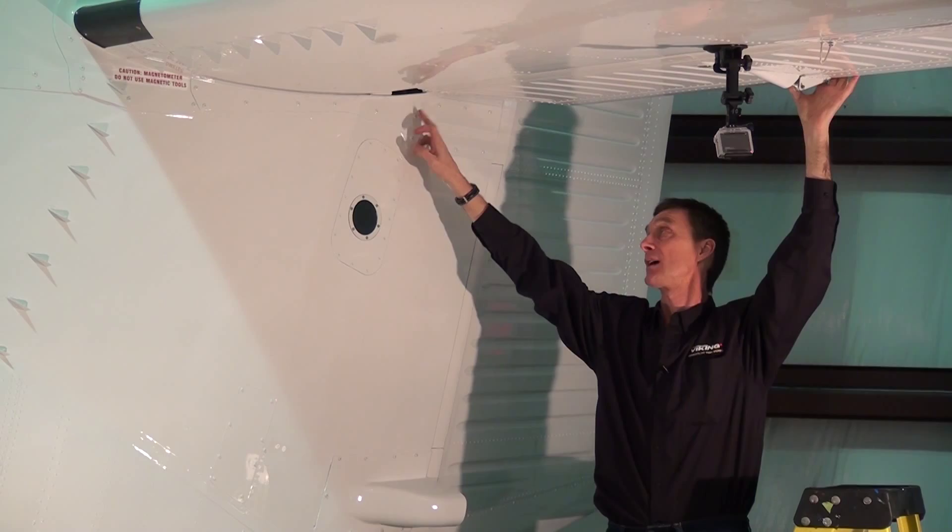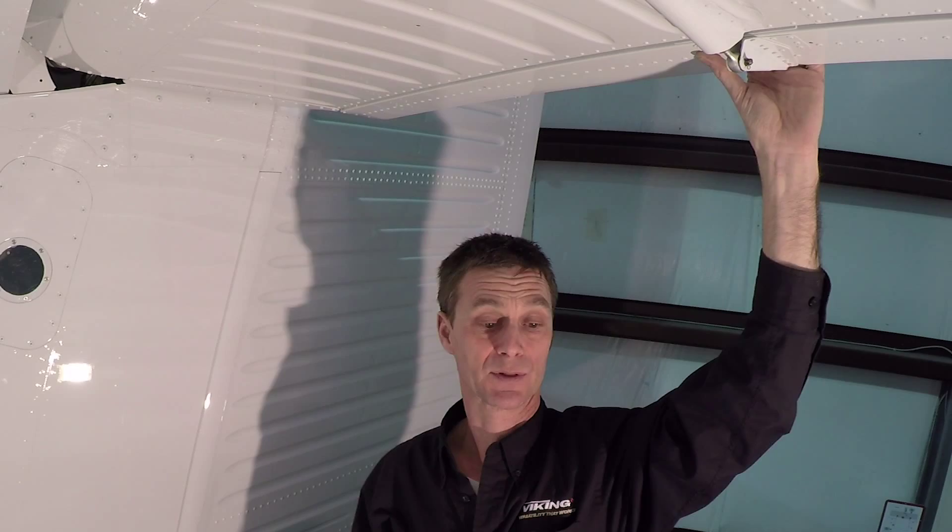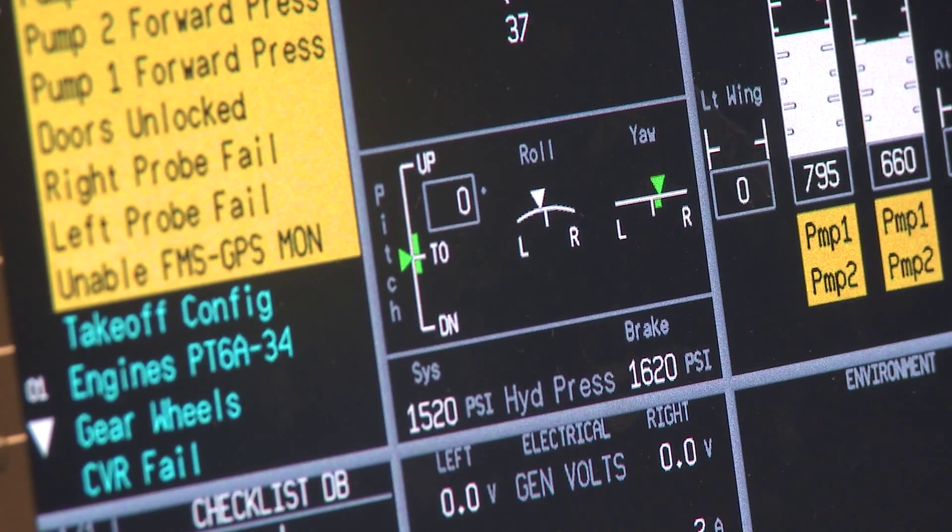The elevator trim control is from the pilot's right-hand armrest. In addition, the rudder trim control is also from the right-hand pilot's armrest. The trim has an electronic indicator on the Apex displays, and a position sensor measuring trim travel — or jack travel — so they can display the amount of trim in the cockpit.